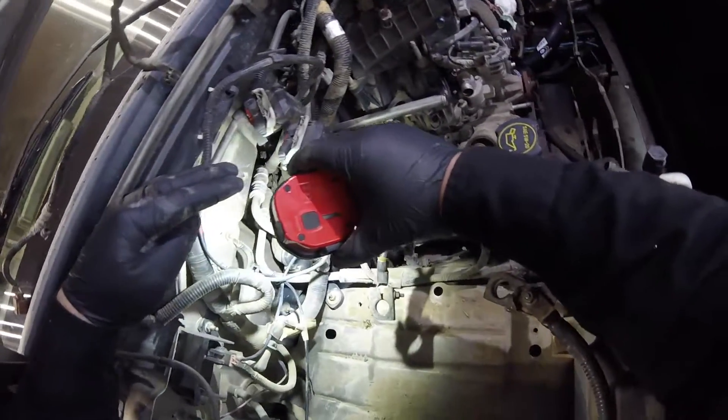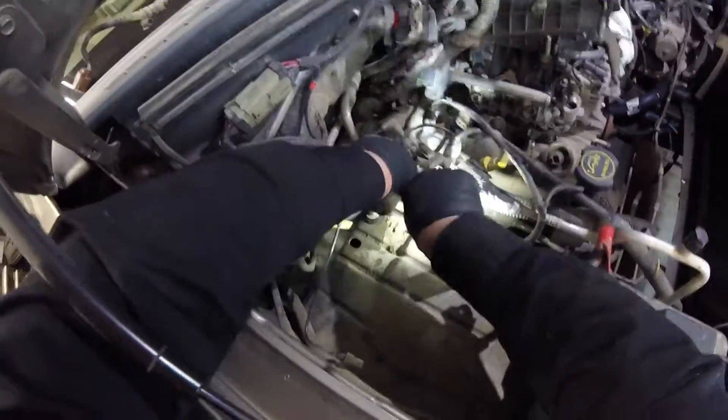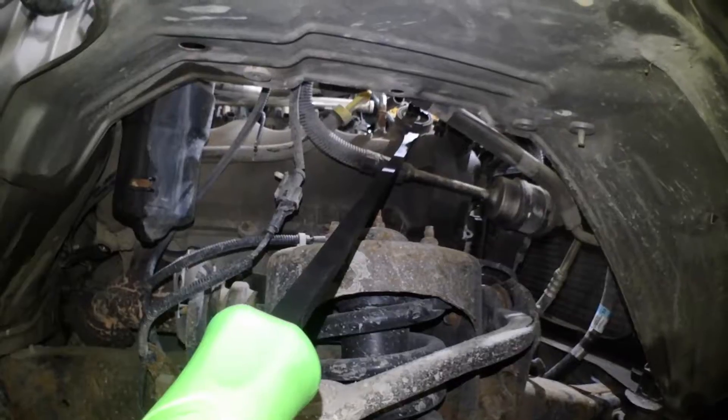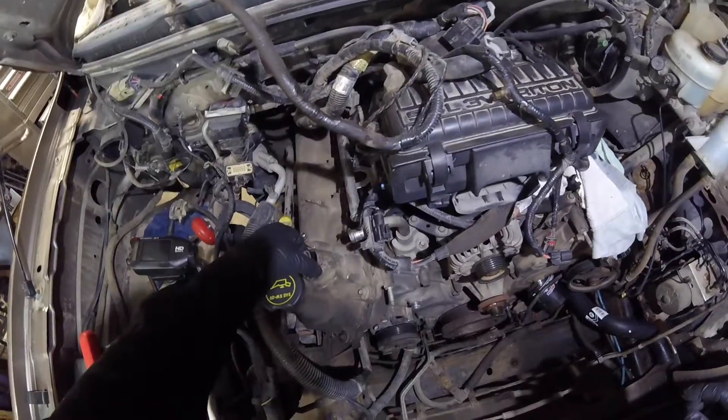I think this is only held on by those two bolts. If I loosen it enough, I wonder if that would give me some wiggle room — it's a seven-sixteenths. Before I start removing the valve cover, I need to remove the VCT solenoid. I took the bolts out and then pulled that up as far as I can go, which gives me some more room. I should be able to wiggle it out pretty easily now — I think I've got a method that's going to work. It went from underneath — got her out.